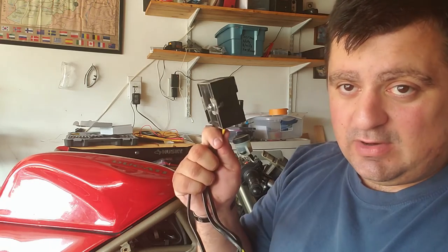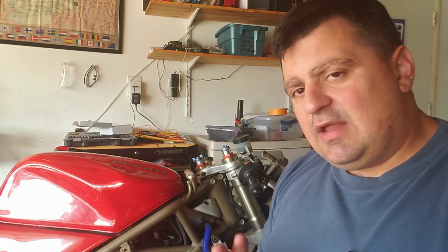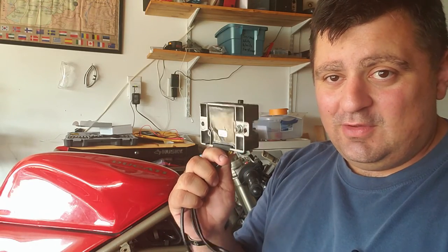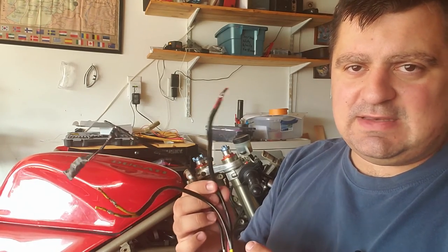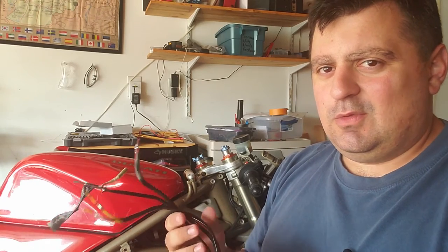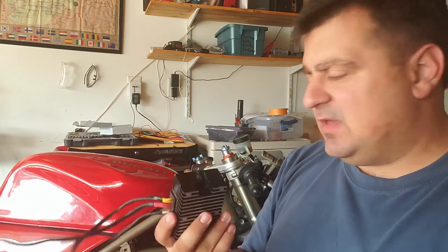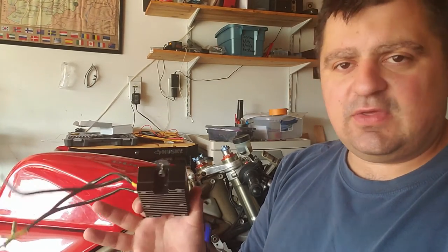Because let me tell you, this regulator rectifier was not wired in correctly. This one, right? Because it should be out of housing. Unless, I might be getting ahead of the game, this might be dead as a doornail. How do I say this? This one might actually be dead and have been wired correctly, but realistically, almost certainly not. Because there's no ground. This was grounded to nothing.